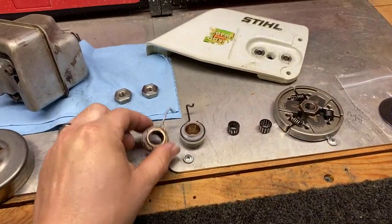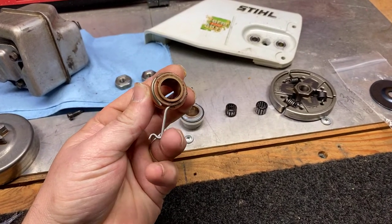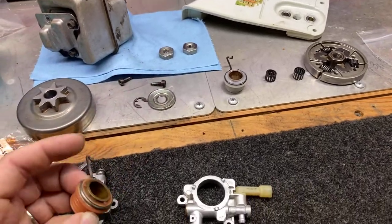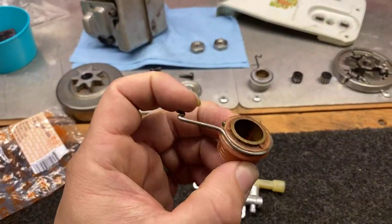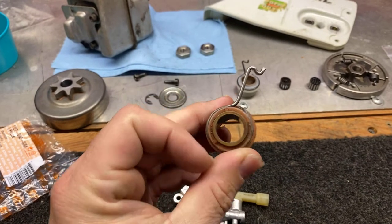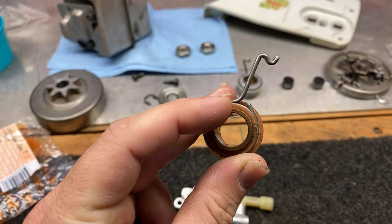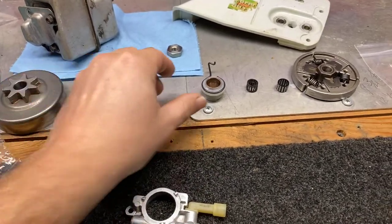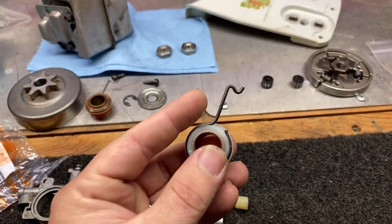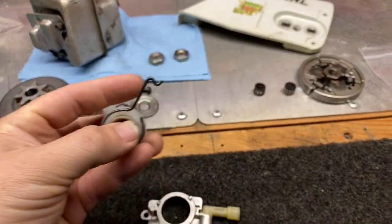I already got the vent on it. Here's the old worm gear. It looks fine, right? Except this - when this pump failed, the worm gear sat here and spun itself loose. If you notice the gap from there to there - don't mind my gross fingernails - see how much bigger it is. They're not supposed to spin; this is supposed to be clamped on there.